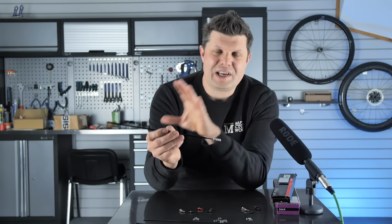And just for comparison, here is the Pirelli one, slightly different. They're like 26 millimeters, not for hookless at all, so you can rule that out potentially straight away. And the 28s need a 17 to 21, etc., etc. So you've kind of got a range already as to what to look for. Now you can start to narrow things down.